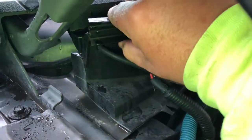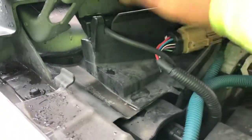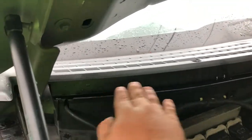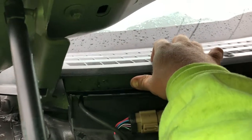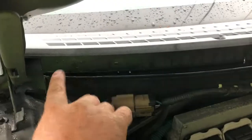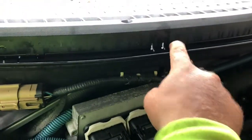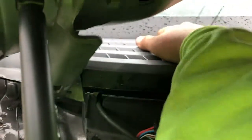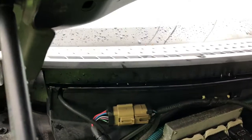You've also got to pop off this weather stripping that's right here - it just pops right off and you have to work it out of its groove. It comes off in one piece. Once you've got that weather stripping off, these just kind of pop out. All you do is push and wiggle them until they pop out of these grooves. There's one right there, another one here, and then some on the back side. Once you get it popped off it's pretty simple, and once these get popped off they're not hard to set back in.